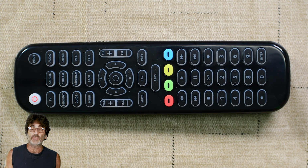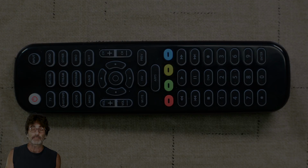Once again, test the functionality of the code. If you've tested the first code that your device responded to and it only partially works, then you'll have to start the process again. This time, don't stop on the first code that your device responds to, but let it pass that code until your device responds again. For example, if you start with your TV turned on and then your TV responds by turning off, wait until the TV comes back on again so you won't be able to stop sending out the codes manually to turn the TV back on again, if that makes any sense.